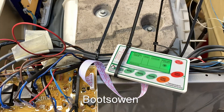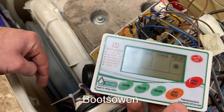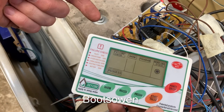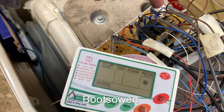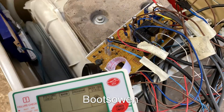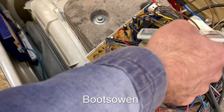Door switch error. This could take all day. I'm not sure about the door switch down there - which way the wires come out or even if it's the correct kind of door switch. It's a door interlock with three wires, should be straightforward. It seems from the wiring diagram that when you turn on the door interlock it drops a solenoid which makes a contact on the neutral to energize all the neutrals on the board through a strip connector. I might have the wrong neutral connected, so these would all have been energized before the door was locked.